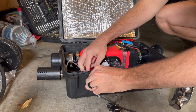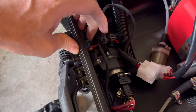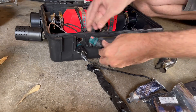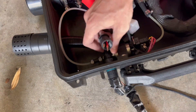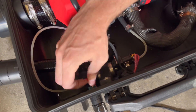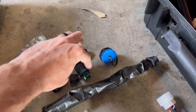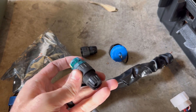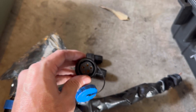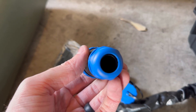Now I'm going to improve the electrical — I talked about this in my initial build and I'm not happy with how these pass-through terminals worked out. I'm going to get a brand new one in there, block off whatever holes are left over, and improve the setup so I can have the wiring separate, because right now I just coil the wiring around the handle. I removed the old ones and got this new one, which has a five-pin setup so I can have all the wires running through one terminal instead of two.